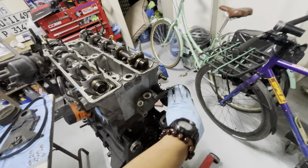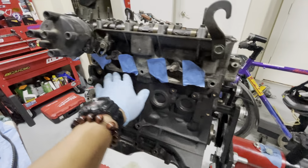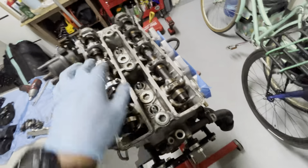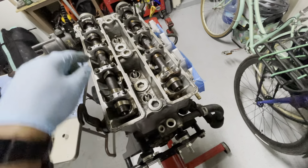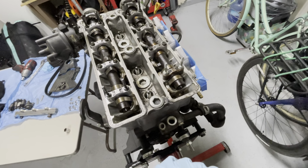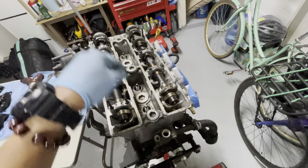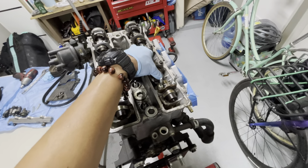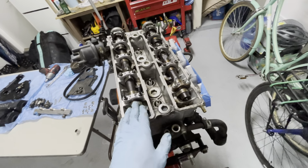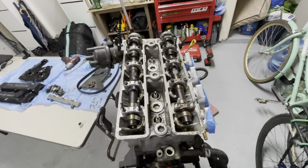But you can tell I do have to disconnect this hose, which I will. And on this side, it's pretty much all emptied out here, so nothing is connected here. So I'm going to disconnect this part right here. And then I'll show you how to remove these camshafts here. There is kind of a torque sequence. I'm trying to remember. I believe it's from inside to outside type of deal, and you do crisscross patterns here. But I'm going to double check that, because if you just zap away these bolts, you end up risking bending the camshafts, because these are under some pressure. So you just want to make sure you do that reversal or removal of these camshafts the right way. So I'm going to look up the manual here too, just to make sure.